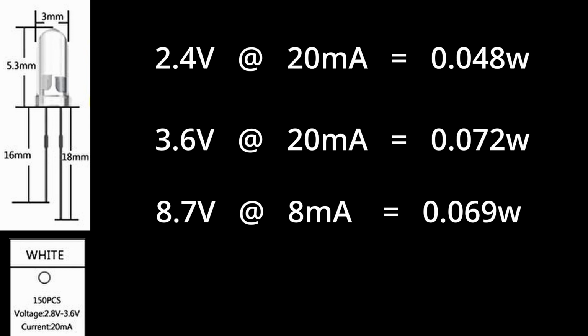It won't give us the brightest LED, but is enough to illuminate it for our purposes, and actually there is enough current to be able to drive 2 LEDs. So of course the light puts some draw on the battery, and obviously it is a small battery in here. However, running an LED at 35 or 40 milliamps isn't going to make a huge dent unless you're using it for hours. I think overall it's a nice modification to make.